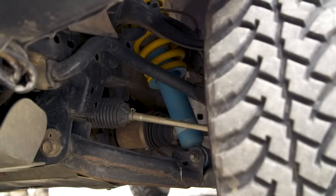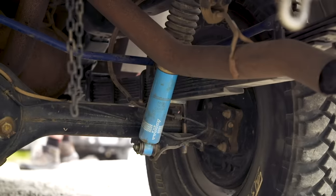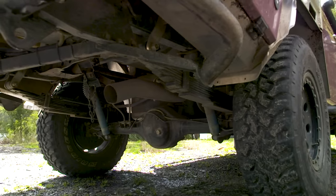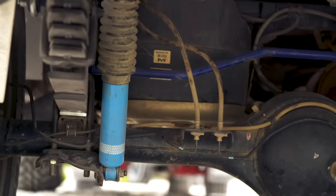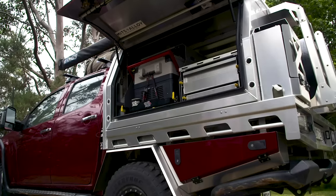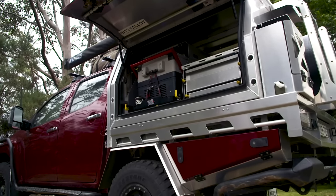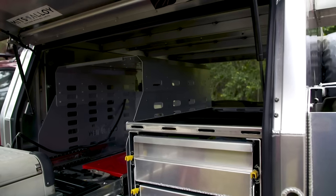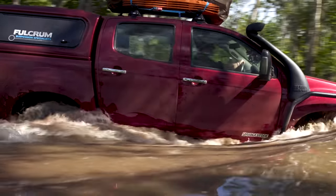The reason you should do this — and I speak from experience of doing it the wrong way myself — is if you get your springs rated for a fairly unmodified four-wheel drive, by the time you add all your mods they'll be overloaded, will sag, and not perform how you want. Then you'll be forking out money a second time to get the right rated springs put in, which could add hundreds to your build cost.